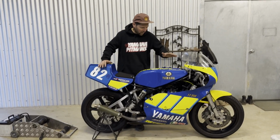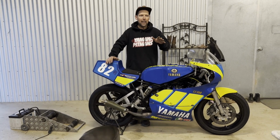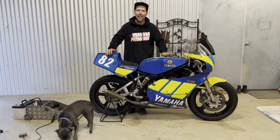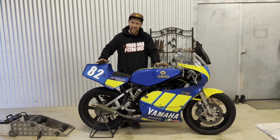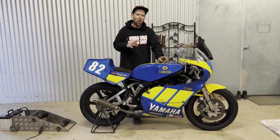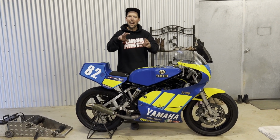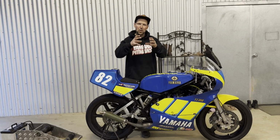Alright guys, so I just warmed up the TZ250. I'll be mainly concentrating on that at the track day tomorrow, but I'm going to take the 350 out again, and I just want to make sure that the clutch isn't slipping this time, so I'll put a new clutch in. Another comment, I had a couple of guys mention in the last video that they saw the clutch boss, where the clutch plates sit into, is quite worn.